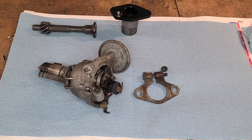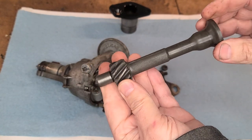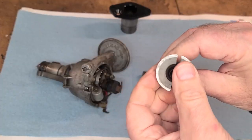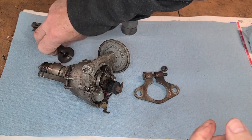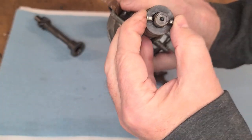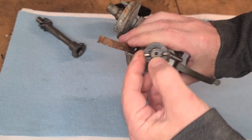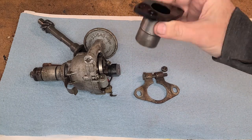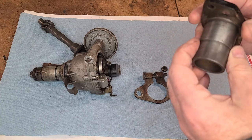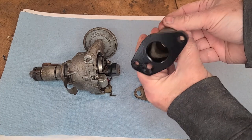In a little while we're going to go over how to install the distributor drive shaft and orient it. Part of the trick is that this center shaft is off center, and that lines up with the bottom of the distributor. The two little tabs at the bottom are slightly off center and they match up with that — the idea being to keep it so you can only install the distributor in one direction. I've already cleaned up and painted the retaining bracket that goes on top of the engine block and holds the distributor drive gear in place.